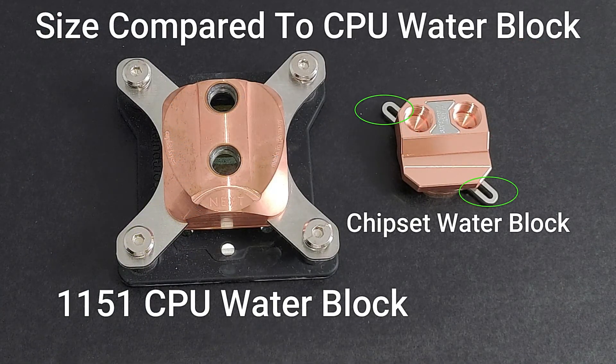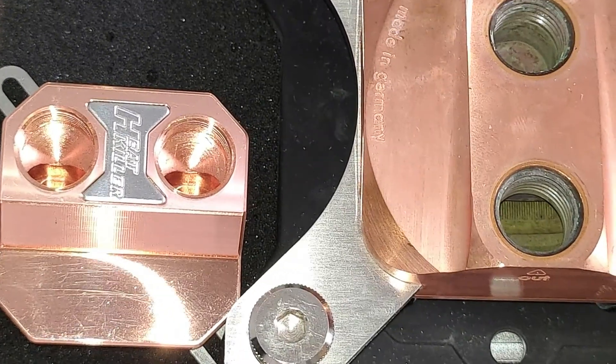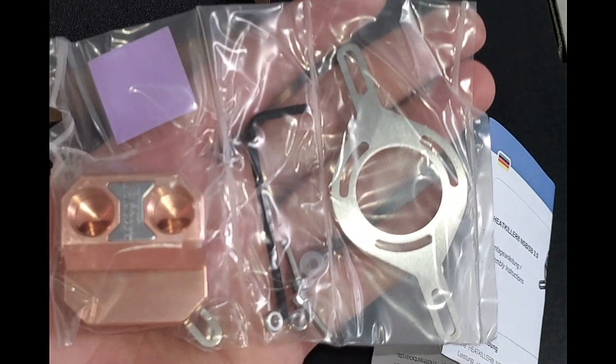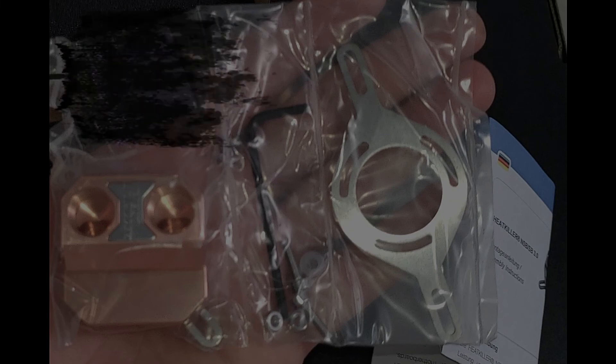The center of the steel bracket is cut out, and you can slide the bracket up and down diagonally to try to get it to match with two of the screw holes. Put the screws through the water block side, put the nylon washers on the backs to give it some padding between the motherboard and the nut that you're going to use to screw down the water block, then screw it down.